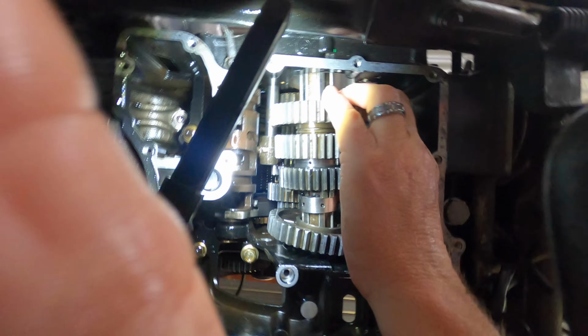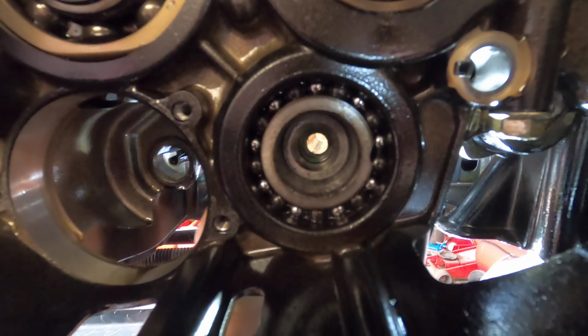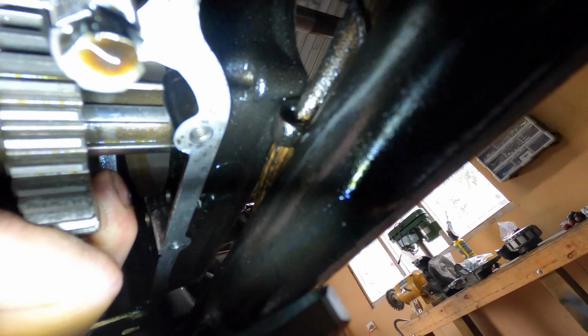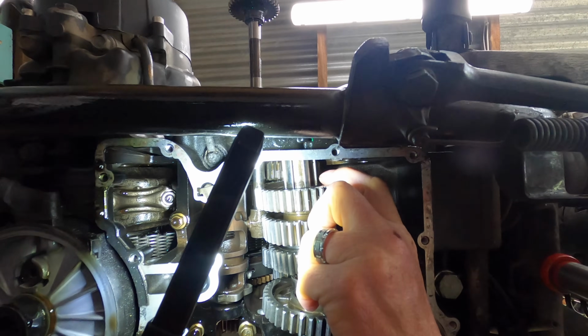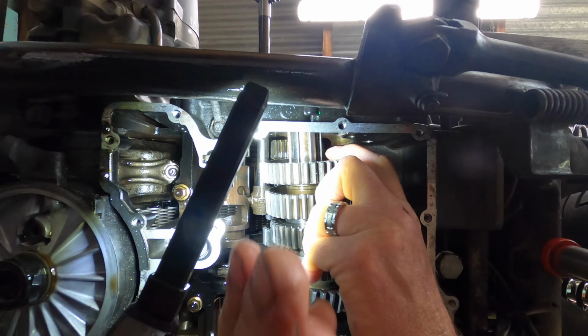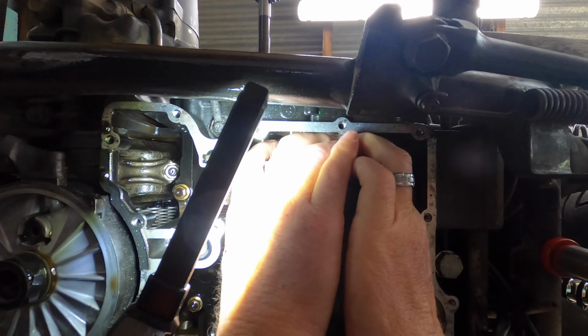Essentially what's going on is the shaft has started in the bearing. When I say started in the bearing, it's resting inside and it's engaged in the radius that is the lead into the inner race. However, up at this end, I don't know whether you can see it or not, hang on, let me turn this around. Up at this end, second gear is hitting the gear above it that normally engages with fifth gear. So diagonally, the measurement's too long to allow it to fit. So I'm trying to figure that out.